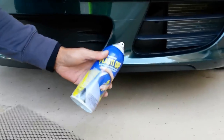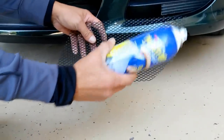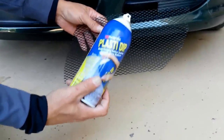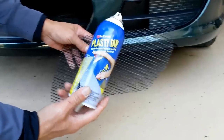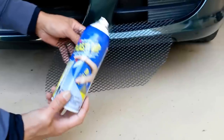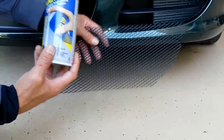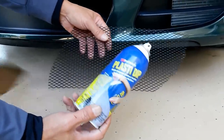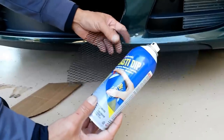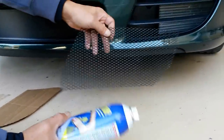The next thing I did was spray-paint the aluminum grills with a plasti-dip material. What's nice about this is it's black, it's a matte finish, and it's a rubberized coating available from Home Depot — also about $5. So this whole project is going to cost me about $8: $2.50 for the one piece of aluminum and about $5.50 for the plasti-dip. This is a great product because it does remain flexible and it doesn't flake off if it's bent or chipped.